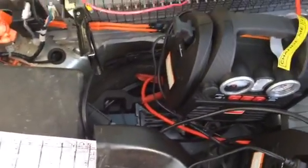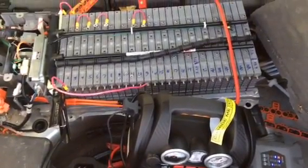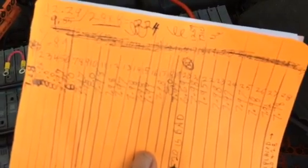When I first opened up the battery last week, I just wrote down the current charge on each battery. Battery number 20 was reading 6.69 volts and battery 28 was reading 7.78 volts. All the other batteries were reading about 8 volts. So I just changed two cells only.